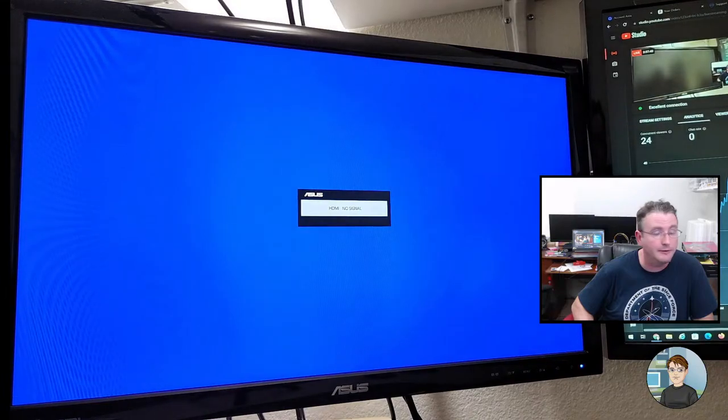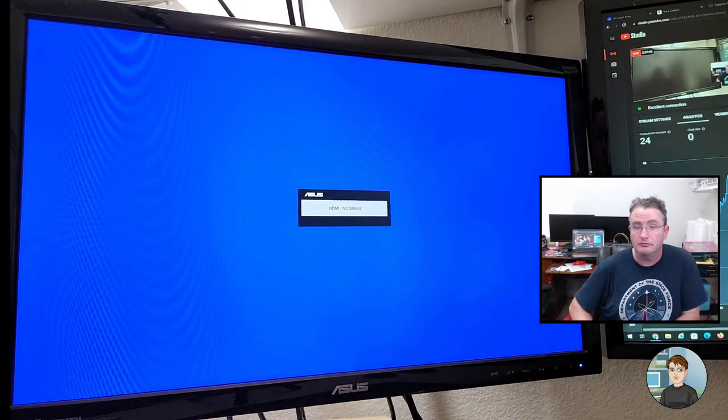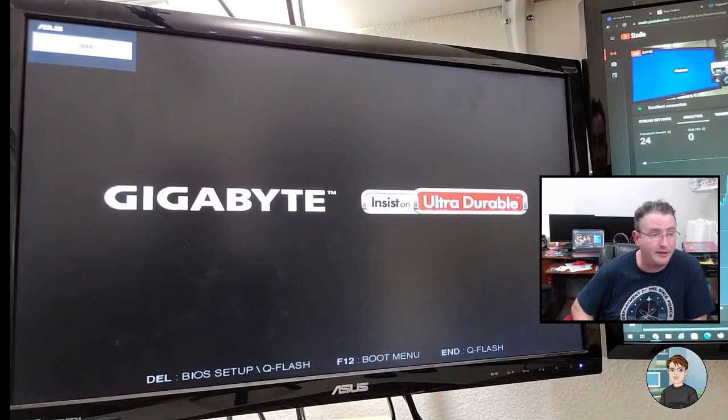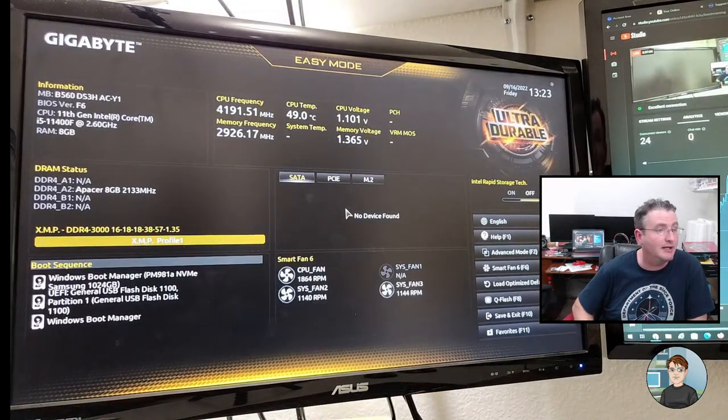All right, and I'm gonna go back in and make sure it actually is running at 3000 megahertz before I let it boot into Windows again. Yes, Dave, I expected that to do it as well. That's the point of the XMP profile, that it would change all the other settings to what it should be according to XMP, but it did not.